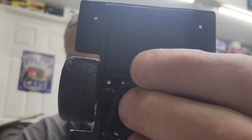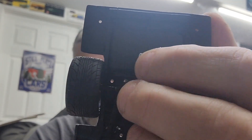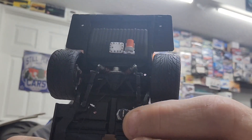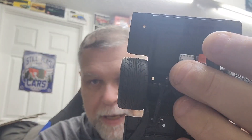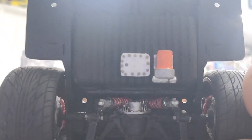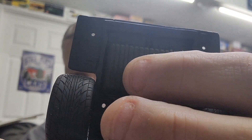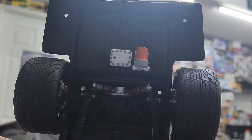We've got our scratch-made plate for the bottom of the gas tank. It's a single line coming out here for fuel — it'll come up to the fuel filter, out of the fuel filter, then to the fuel pump, and from the fuel pump up to the front of the car and up to the engine. So we got all the braided lines and fittings we've got to put in here and get that all painted. These are those little bolt details — they work really slick. I'll come back, mask off around it, then chrome that up or aluminum it and then chrome the bolts.